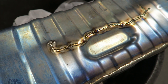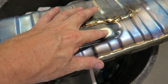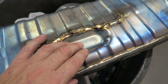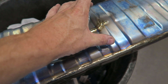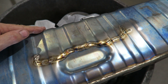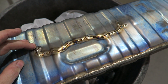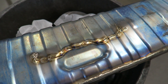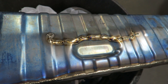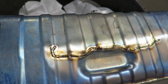As I mentioned to the customer — if this is something that continues, if it keeps doing this, what we could do is basically put a plate across here, kind of a patch, bring it up to this high side and roll it around to reinforce it — put some 16 gauge sheet on there. We'll report back if this cracks again. If you have a Porsche muffler and you're looking at doing this, let us know — we have a lot of experience with titanium and we can take care of it for you.